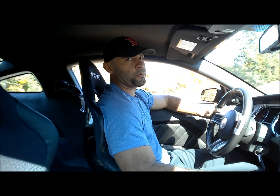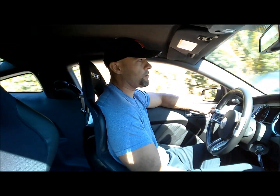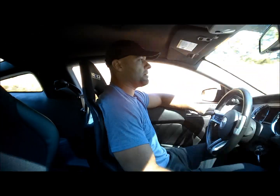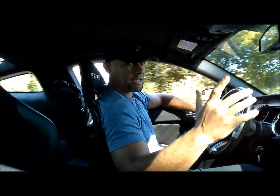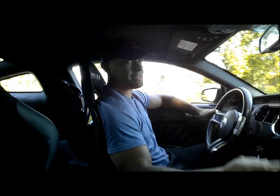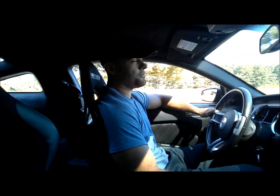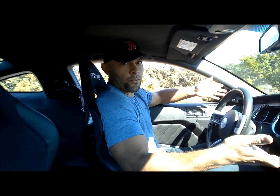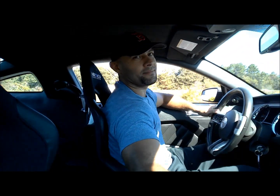See, it still lights them up pretty good, being a car that has 285/40 rubber in the back, 373 factory stuff, lowering springs and a Bama tune. The car has run a best of a 12.2 at 114, 115. I think it trapped 116 once, but it was on a shitty run, shitty 60 foot. But hopefully that'll answer some of your questions as to how I got it to do what it did in that video, and I was able to duplicate it. I hope you guys enjoyed.